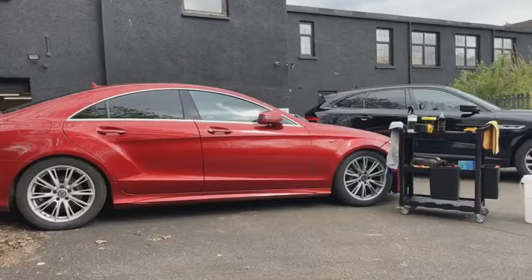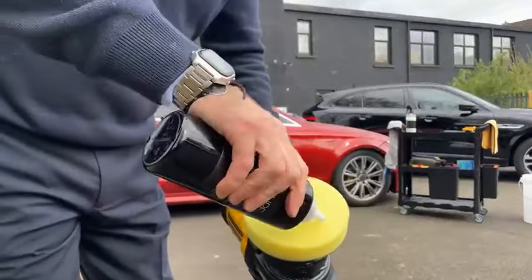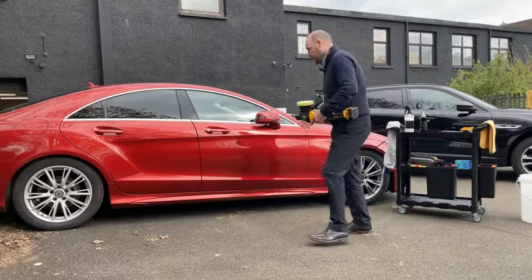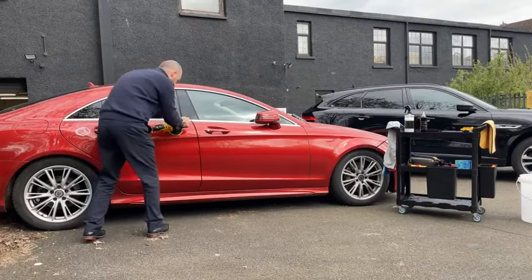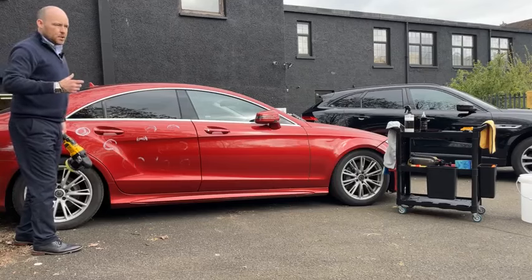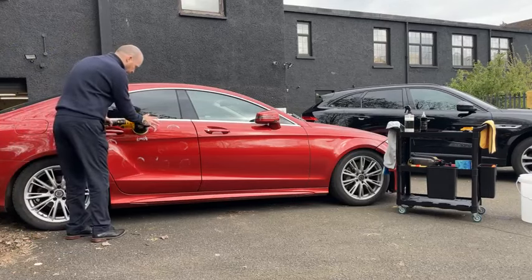Take your Pure, give it a shake, and all you're doing is applying some Pure to the pad. Start on this side and work down. Spread some of the polish across the panel you're going to be working on. We're not so much working to put the product in as an abrasive, but we will be working it in to an extent just because I want to deep clean the paint. So three and a half thousand RPM, pad flat to the panel.